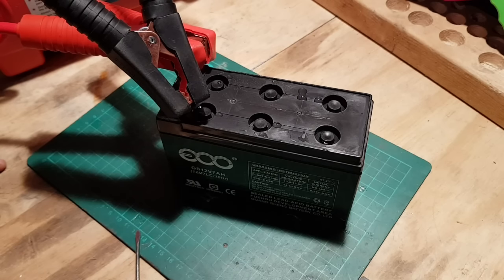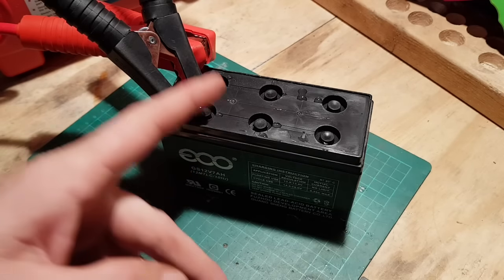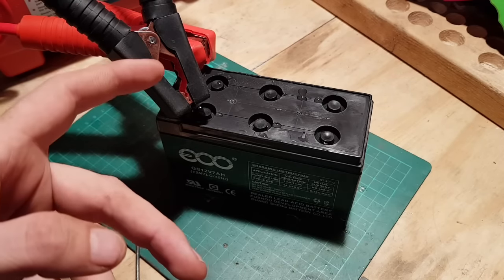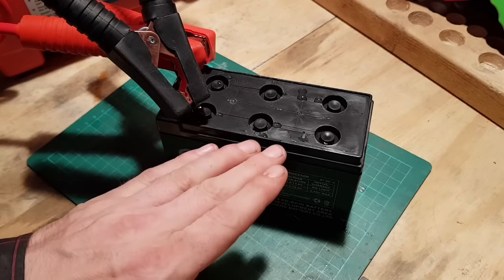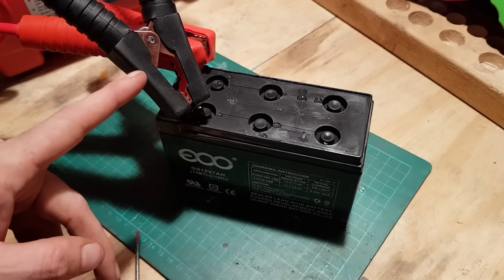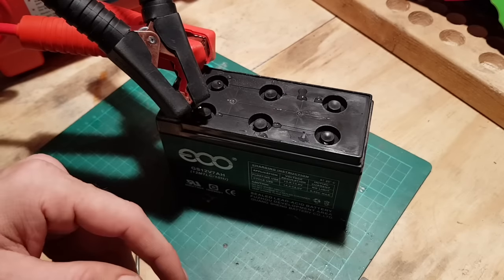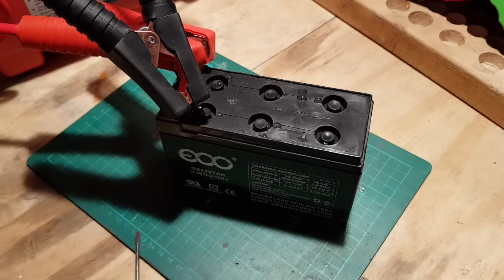If there's not enough volts in the battery, smart chargers will not detect it — that's what people mean by they're too smart for their own good. They're handy for the newer lipo and lithium ion batteries because those are seriously dangerous if used wrong — they can be very explosive. So we'll leave this just now, come back and check on it, see where the amperage is at. Once it's off, we'll look inside the caps and see if the water's dropped below the cells, and if so we'll top it up.